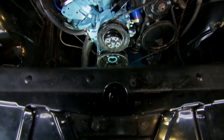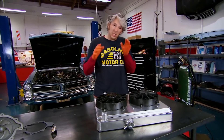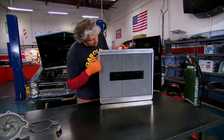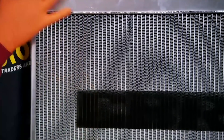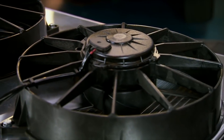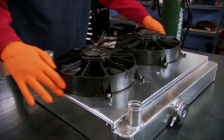I looked online for an uprated rad suitable for this car but most won't occupy exactly the same cavity and the hose positions may be different. The way around that is to go bespoke. This is our new aluminium radiator - we had it specially made so we know it's going to fit perfectly. Being aluminium it will disperse heat more easily, and better than that we've got 50% more radiator cores so there's more fluid flowing around dispersing even more heat. The two fans are separately wired - one comes on at a certain temperature, the second comes on when the air conditioning is turned on. This setup costs $1,300 but it's definitely worth every cent.